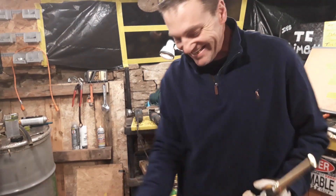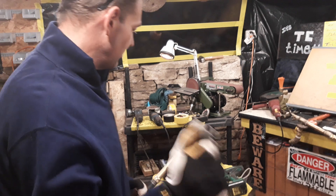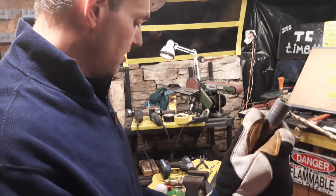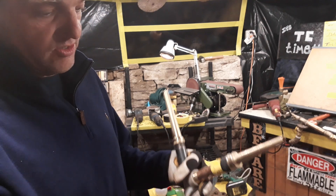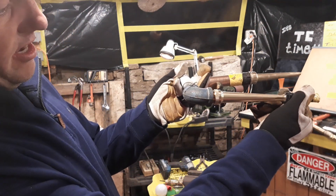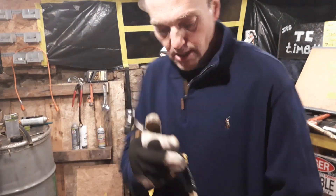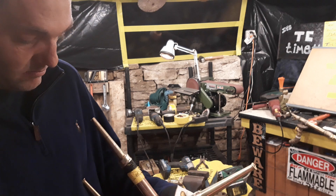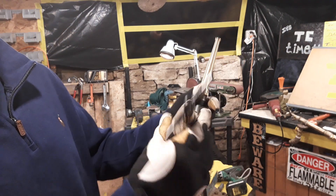This one's a little bigger than the original — I got different sizes so I could play with it. This is a sprinkler fitting, and I got it for this tip right here. This tip slides right on, no problem. It won't slide over the original tip, so my first option was to cut the tip off. When I compress it down, I put my deburring tool right in there to make absolutely sure that I did not compress that hole any further than I wanted to.